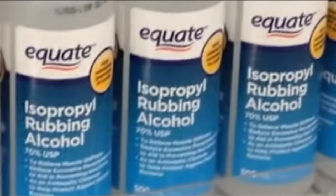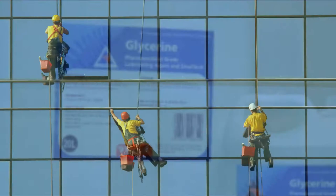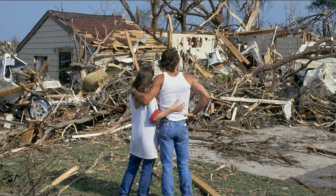Before we begin, it's almost as important to point out what methods you simply shouldn't use. Please do not use rubbing alcohol. Sure it contains isopropyl alcohol, but it's been mixed with a lubricant called glycerine that leaves a layer of film on your pins. Similarly, window cleaner, brass cleaner, your breath and saliva can all do more damage than good by not fully removing dirt, residue, or in your breath's case, promote oxidisation — all things you set out to resolve in the first place.